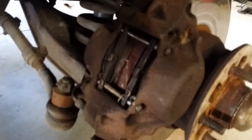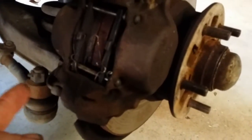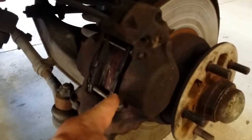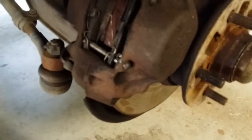I already did this side just a little while ago. Brake pads are great, but only one pad's been working — it happens to be this one, which was on the other side. I just flipped it from that side to here. Basically this piston is the only one that's been working on the other side. The brake pads were grabbing this pin and they weren't sliding back and forth like they should have, so you got to keep that stuff real clean. I had these really long cotter pins so I just got them bent up in there — it works good. But see that little spring, that little clip, that keeps them from clacking and carrying on. It was cracked on the other side and broke, so I got to get one of those.